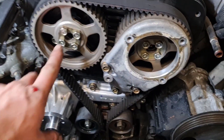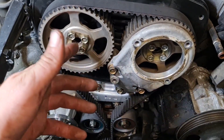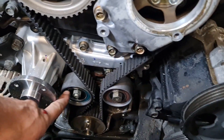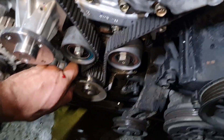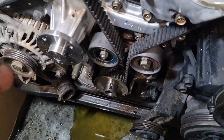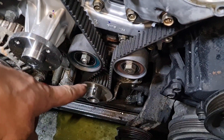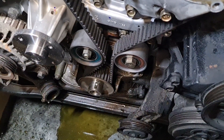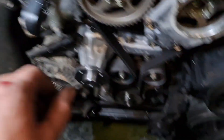This is the point I like to double-check everything. Make sure that these cam bolts are 100% done up — obviously if the cam gear comes loose, you're in trouble. Double-check your tension, your idler nut and bolt. Make sure that this shim is on here, because if that shim's not on there your belt will get chewed to bits. Make sure your dowel's in there — definitely don't want that one missing out of the bottom pulley. If you miss something here, it's a pain to get back to it.